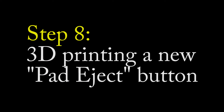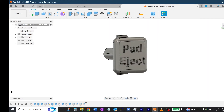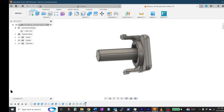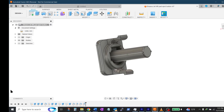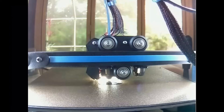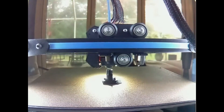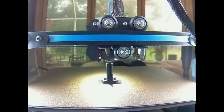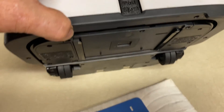One final small item: I noted at the start that the pad eject button is mysteriously missing from my robot. I took a picture and measured and modeled a new button in Fusion 360. The long post contacts a sprung lever inside the unit to eject the mop head, and the two hooks are what keep it from popping out again. So I sliced and printed it on my Ender 3 V2. The very first attempt was almost perfect — the long post snapped off too easily. So I printed a second one with infill set to 100%, pure plastic, so it's as strong as it can be for PLA. It snaps into place and stays there, and works perfectly to eject the mop as it should.